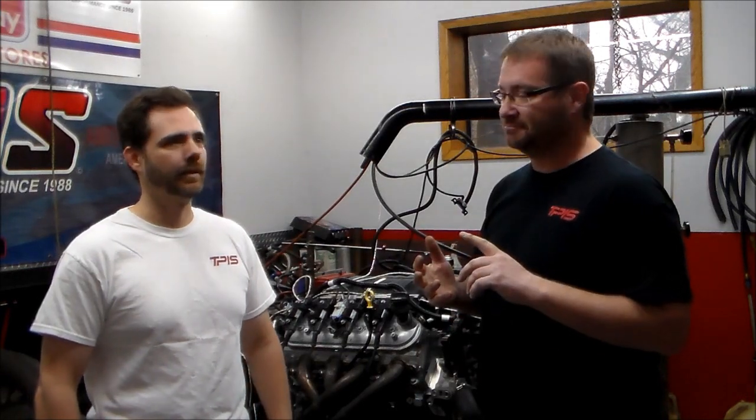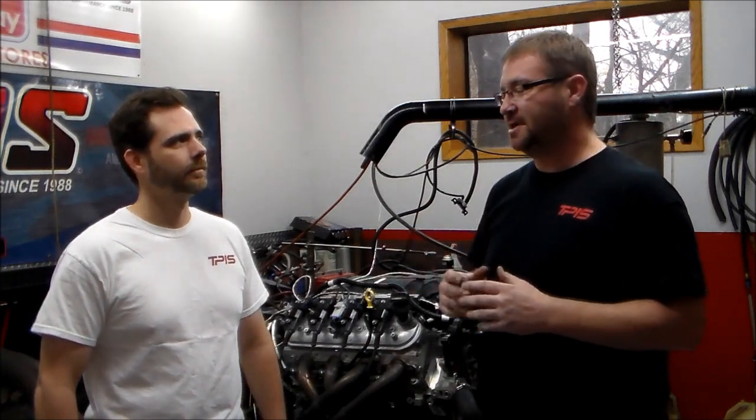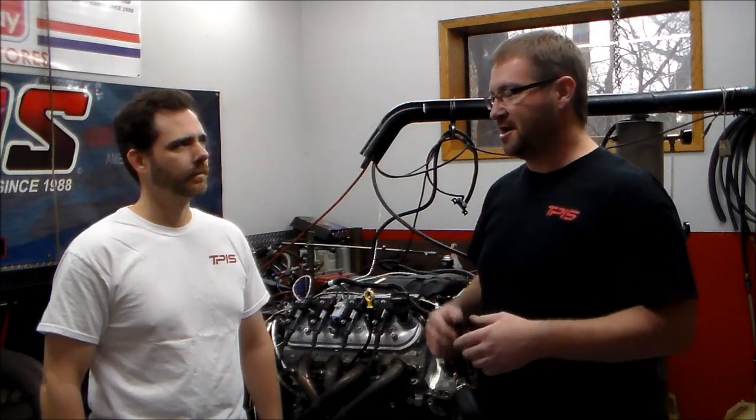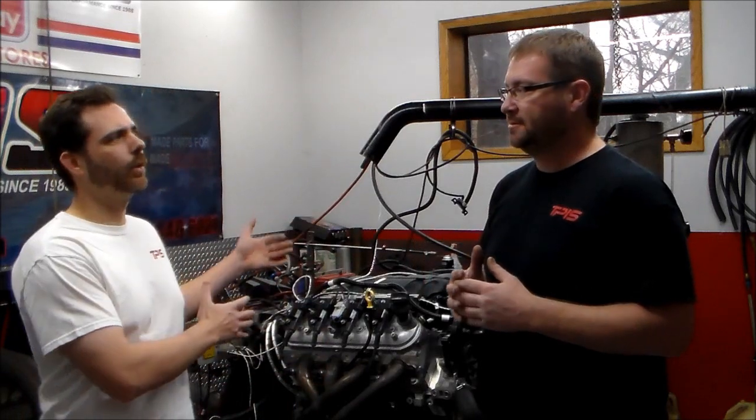It's always a good thing — you can verify you have good oil pressure. Really the most important thing I feel about breaking in a motor is seating the piston rings as quickly as possible, so you don't glaze the cylinders. That's a huge problem with customers where they put an engine in a car and it burns oil from day one, because they sat in their garage for a half hour setting the timing, or it leaked and they shut it off.